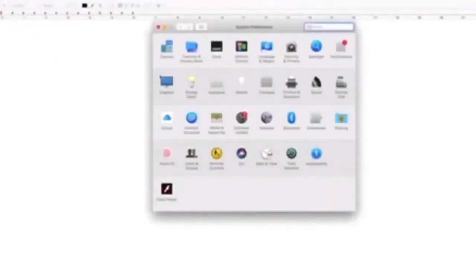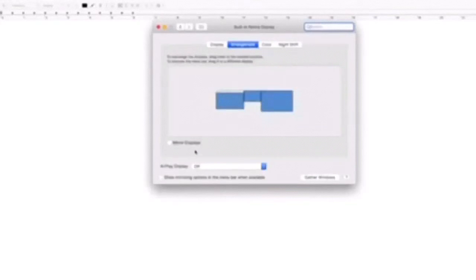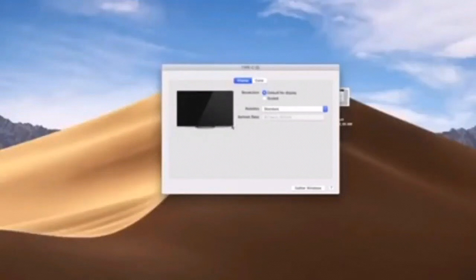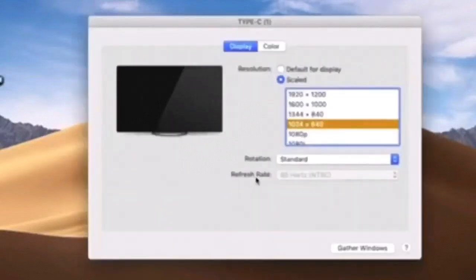To configure your display on a MacBook, open up System Preferences and select Displays from the menu. Click Arrangement from that display menu. Make sure the Mirror Displays box is unchecked. Here you'll click and drag the screens to configure as shown. The screen with the white bar on top represents your laptop's actual screen. As you click on each box to the left and right, you'll notice that they light up in red — this lets you know which screen is which. To zoom in, click the display menu on that screen and click the Scaled radio button. You can select 1344x840 or 1024x640. If any screens are upside down, click the Rotation drop-down menu and select 180 degrees.